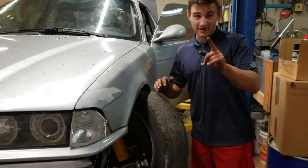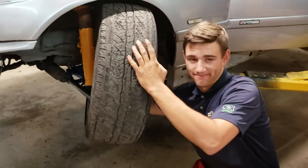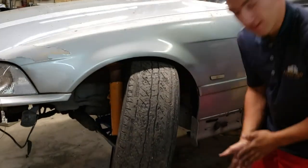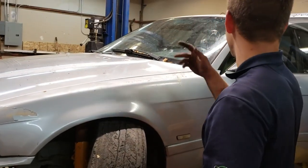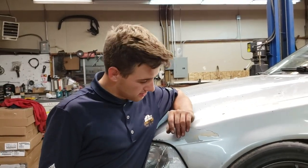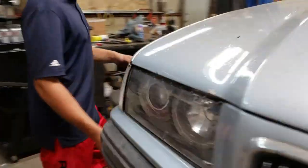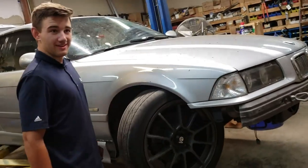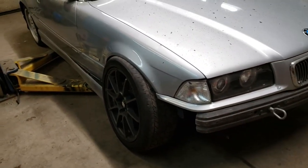It's not as much angle as my SLR kit, and it also hits the frame. So we're gonna need to run more of a spacer to space it out, and then we'll be able to run this properly. This is zero adjustment setup on the Wise Fab kit. The tire is literally pressing against the fender and the lift isn't even all the way down — it's just crunching the tire. So we're gonna have to cut the fender.